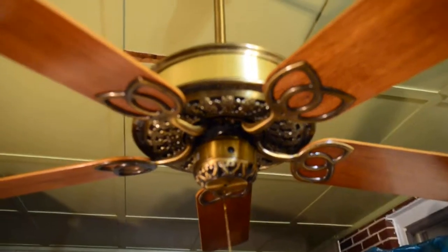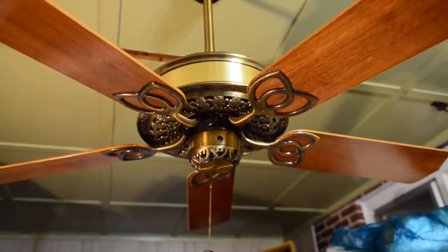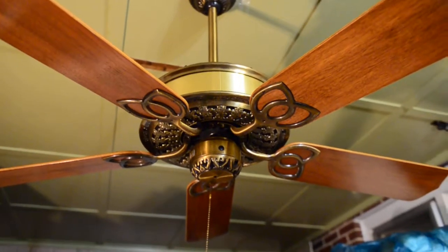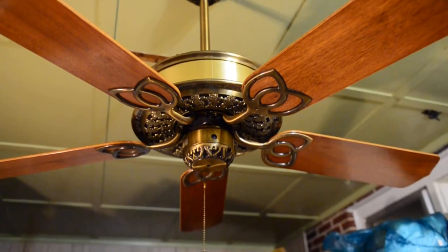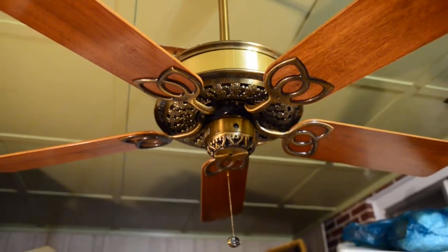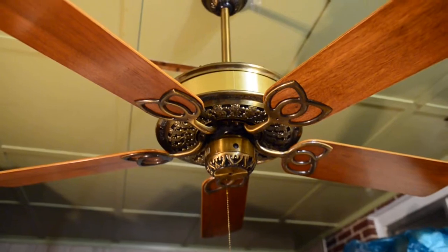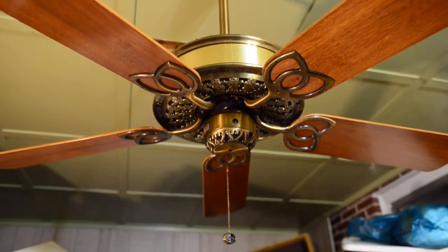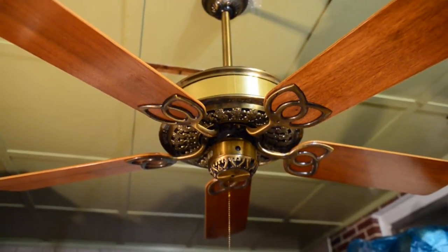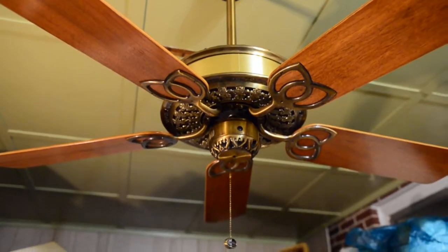which is interesting. Victorians in general were either slumber quiet, variable speed, or IntelliTouch. 3-speed, those don't surface that often. For the most part, 3-speed fans were available briefly in the late 80s, between I think like 86 through 88, possibly 89 as well. This one's from 1990. It's a bit late for 3-speed because the 1990 catalog lists the Victorian as IntelliTouch only. So this one's a little weird.